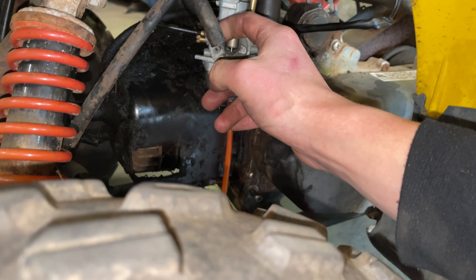It's the next day. I completely redid the fuel system and just rebuilt the carburetor once again because our float still was not working — it wouldn't let any fuel in, which is why it wouldn't run. I don't even know if I filmed me trying to start it yesterday. We'll turn the fuel on — no leaks yet. Maybe we try to start it and see what happens.